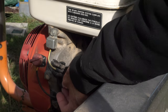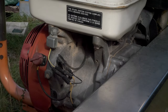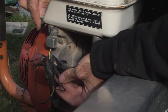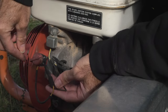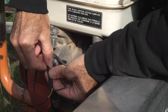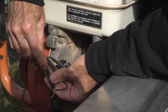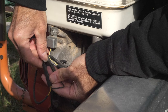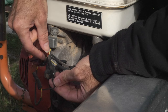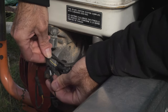Try to open the wire retainer. Now disconnect the two leads of the old switch assembly. Sometimes it's a little hard to tell where to pull. If you look at the yellow wire coming out, you're going to pull this upper end — you should be able to see a little separation there. That's going to pull out of the top, and then for the black wire, that's going to pull out closest to the wire.